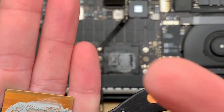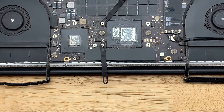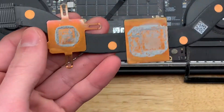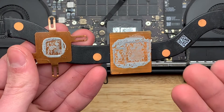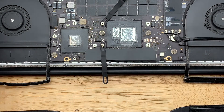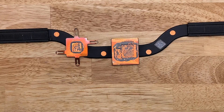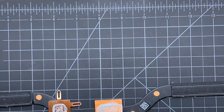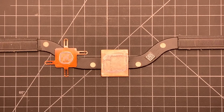That stuff is pretty crusty and very dry. Nothing even came off onto my finger, so it was definitely due for replacement. I'm going to first remove the old heat sink compound from the heat sink itself, just as a little bit of better practice for doing it on the board. So I'm going to set the board carefully aside for now, and definitely set your computer in a place where it's not going to get damaged.